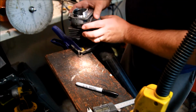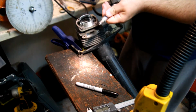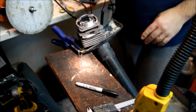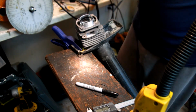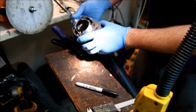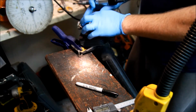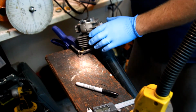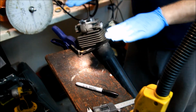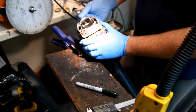So now I'm going to grind to that line, and I'm going to try to square off the intake a little bit. Nice thing about intakes is that they don't have rings that go past them, but once, during installation. So in general, you don't need to worry about a ring hooking quite as much. I'm going to turn the vacuum on, but I'm just going to go in here and work on that. Pretty double check with the piston. Looks pretty flat, that line. Looks like it's curved, but it isn't. So you want a nice crisp opening on the intake, if at all possible. And a flat line, a flat floor here, gives you that. So I'm just going to go up in here and grind this way.